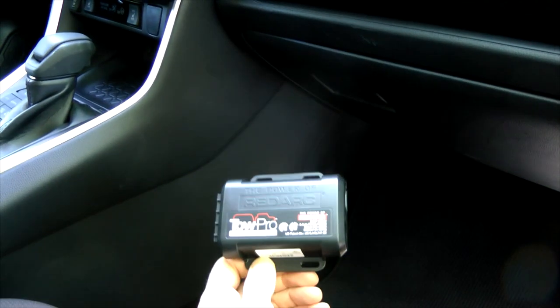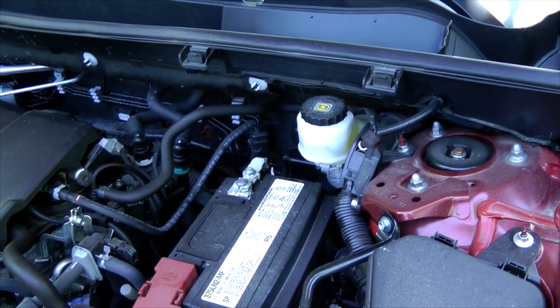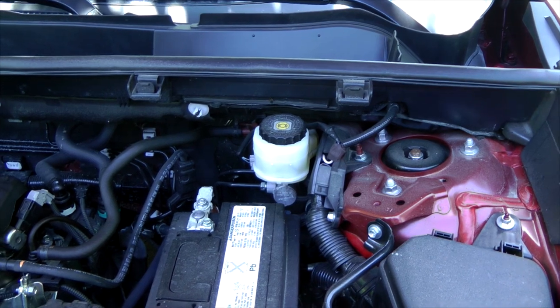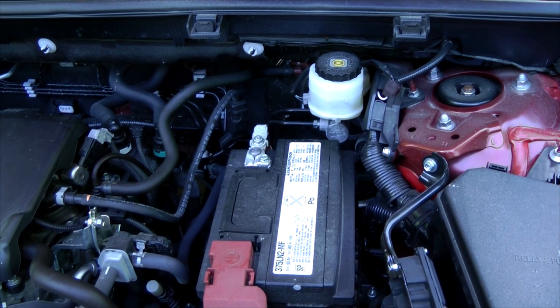The best place for installation of the main unit is here — there is more than enough room. Of course you have to find some brackets to finalize the installation. The connection for the electric brake controller starts from the battery, then goes down through the firewall to the cabin, and will spread to the left and right side. The left side will be for the light converter installation, and through the right side will be installation for the 7-blade and 4-pin electric connectors at the back of the car.